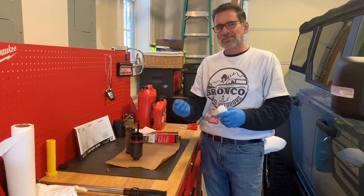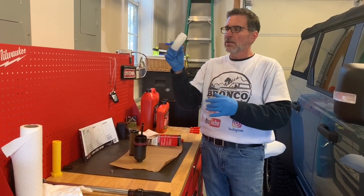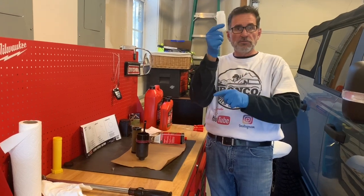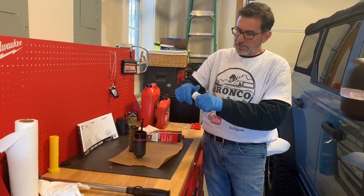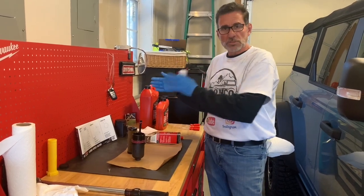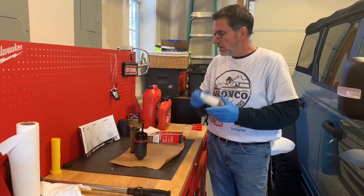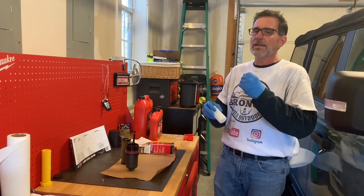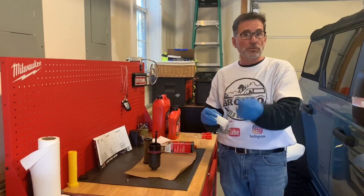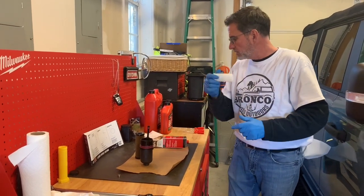So once the oil starts coming out, once you remove the plug, you would grab a bottle and fill it up in the stream, move the bottle, put the cap back on it, and tighten it up. We'll show you at the end of the video what to do with this. I just want to make sure that was clear. I didn't forget to do it, and no, I would never take a sample from a dirty canister. That's just how we're going to do it here.